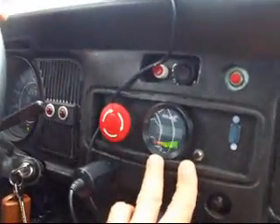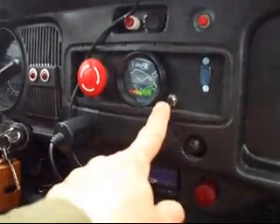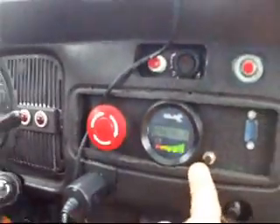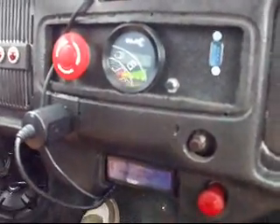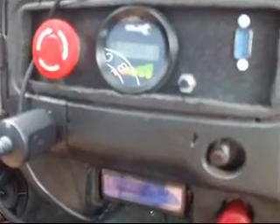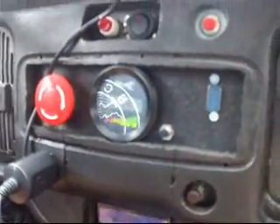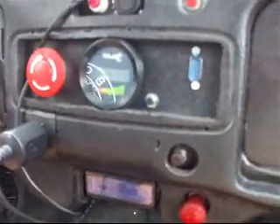Is this a system voltage? Yeah. What is the actual voltage? We're running nominal 96 volts. That's 32 times 3 — it's 3 times 160 amp hours, so we have roughly 50 kilowatt hours. Can you see the voltage change when you use the regen brakes? It certainly has a sag — about 102, 108. Yeah, there's regen braking, it's quite pronounced. It shows minus amps too.